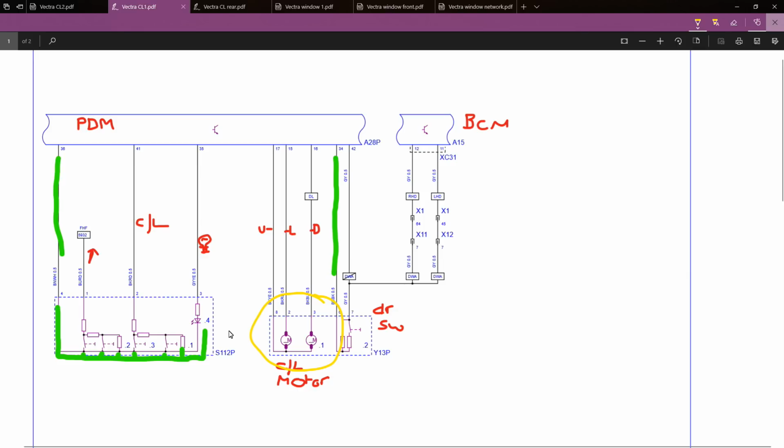So that's that. The first thing is you always look for a path to ground or a path to power, so either something leading to a fuse or something leading to a ground point. I'm in the fortunate position that I've got an old copy of TIS, and I'm able to pick the low references out, but you can actually see it. If I erase this ink, I'll try and get rid of it.